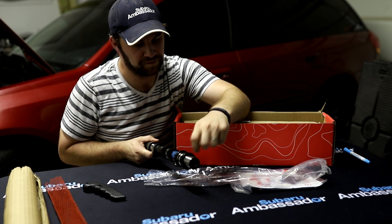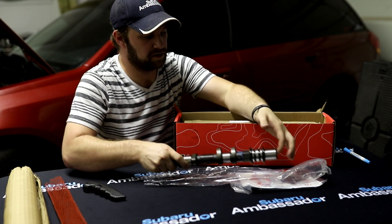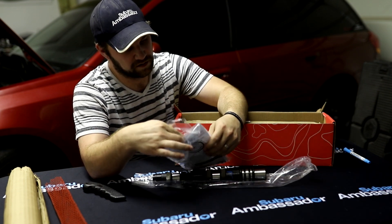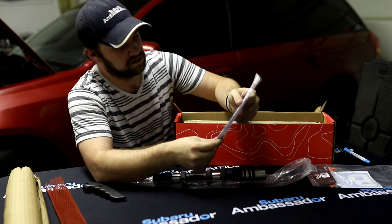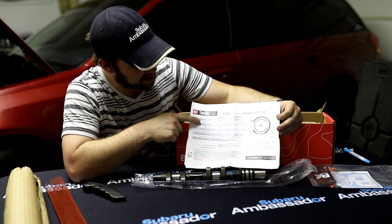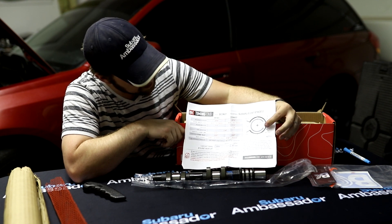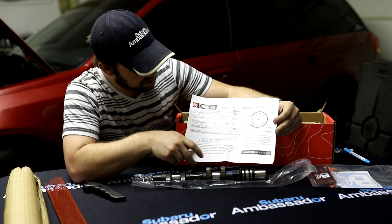The oil comes in with your oil control valve and then into your cam sprocket to retard or advance timing, which we know all about. Next you get a cam card, and this basically tells you all about your cam — it tells you the lift, your actual cam lift, how much lobe separation there is, and it should tell you overlap. Based on this picture you can figure that out.